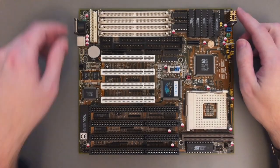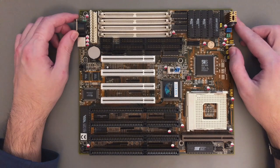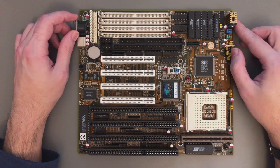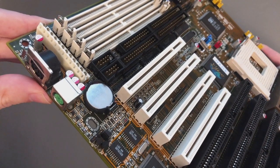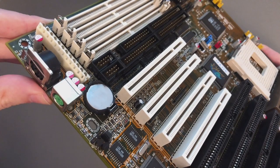The capacitors I used are these ones — the only ones in the 0603 package that also have high capacitance and X7R dielectric. So that's all with recapping. You might ask: was there any difference? In the end maybe I didn't notice something significant, but it's nice to know I have the best of the best here in terms of stability and capacitors. I really like the looks of it too — the PS2 port, the battery, the capacitors — this definitely does not look like a 486 motherboard anymore.